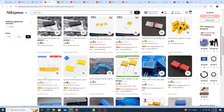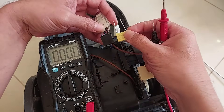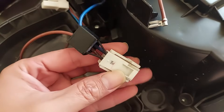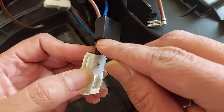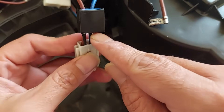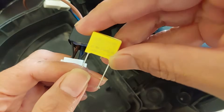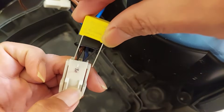Let's replace this old capacitor. There are many types and brands for this capacitor - as long as the value and voltage are the same, you can use it. Also consider the size - there are bigger and smaller capacitors. Try to find a similar size because this machine has limited space. For easy replacement, I just cut the two legs and solder wire to them later, as it's very hard to pull the capacitor legs out from the socket. It doesn't matter which orientation you install it because this type of capacitor has no polarity - no negative or positive legs, so you can install it either way.